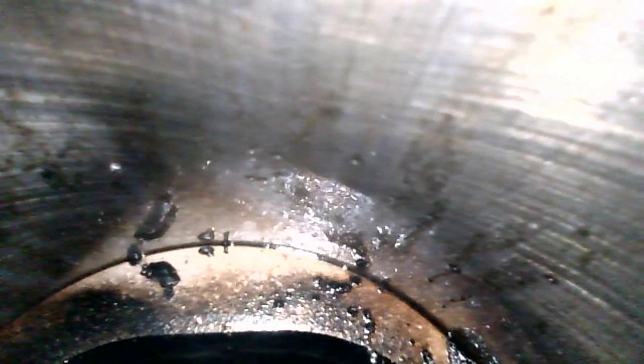Those look like oil streaks going up and down the side of the engine. Do we see scoring? Is that scoring up there near the top, or can we still see the cross-hatching through that? I think we can still see the cross-hatching. There is scoring going up and down it looks like, but there's no up and down scoring on the side — there is on the back. How bad is it? Does it look bad enough that it would be causing a divot or a bowl in the side of the cylinder? I don't think it does because I can still see the cross-hatching through there.